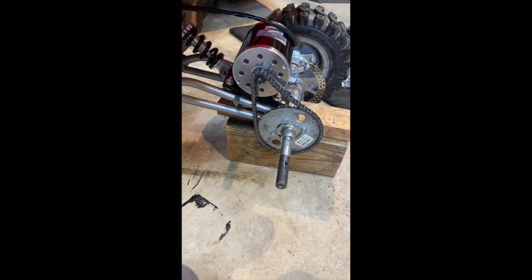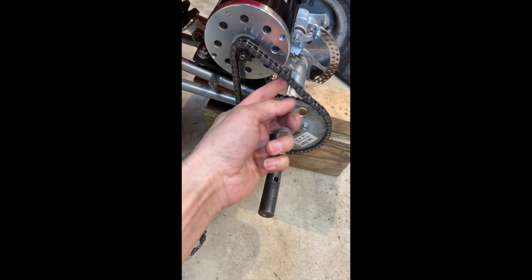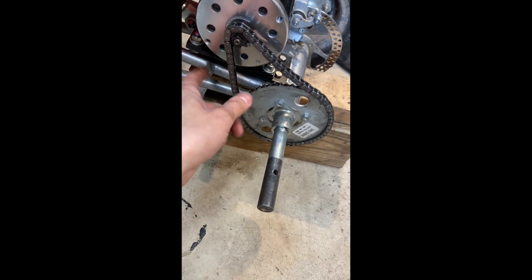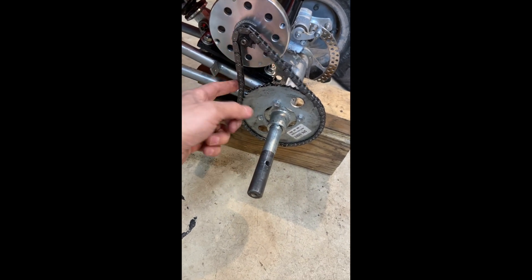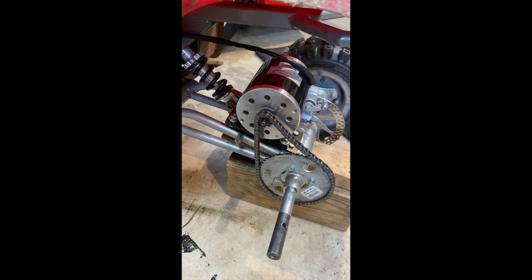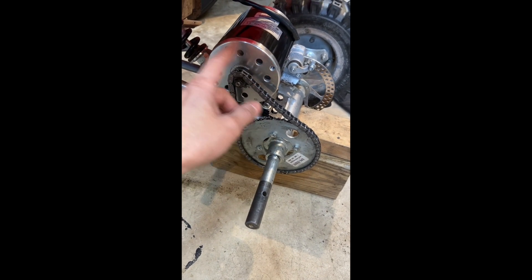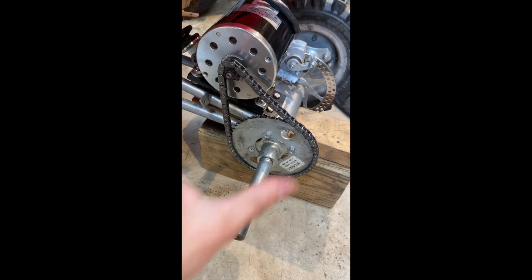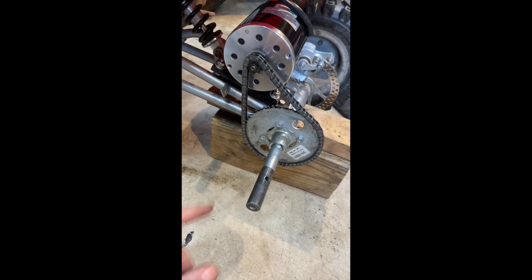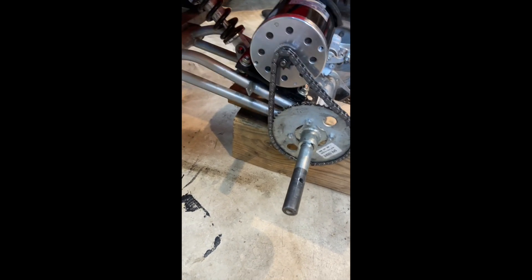Here's the final chain setup - no chain tensioner, it just won't fit. I've got the chain set up on an 8 millimeter chain with a little bit of play, but not nearly enough to jump the sprocket. It's lubed up and running on a 10 tooth 8 millimeter pinion and a 54 tooth sprocket. Before I put the chain guard on I need to do a little modification - the motor housing is so much bigger than the stock motor that the chain guard needs to be dremeled out.